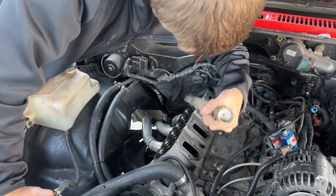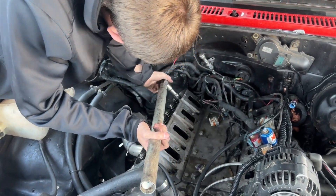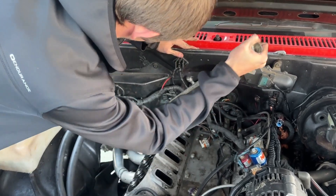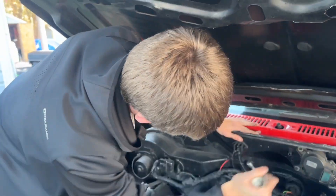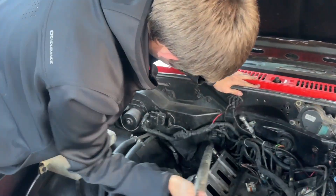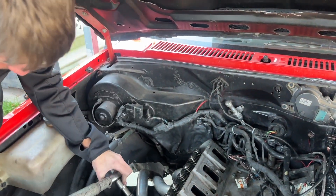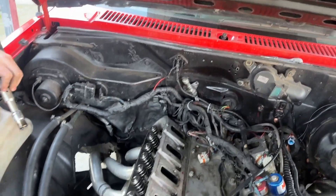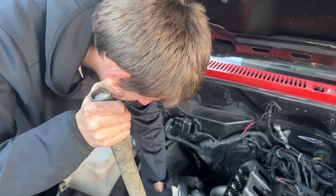He's got a cheater bar out here talking to a freaking customer. Okay, rocking and rolling getting these heads off. I appreciate that Gabe, I appreciate you working on your vehicle. Get all the washers off the top and stuff, keeping up with them all. Go through and get all those nuts off, get the washers off, put them in the bag over there, then we'll slide the headers back. I'll get a pry bar - watch out Shadow.